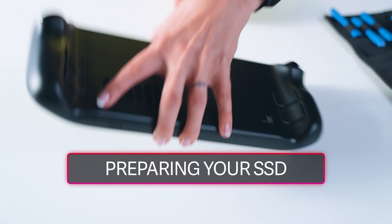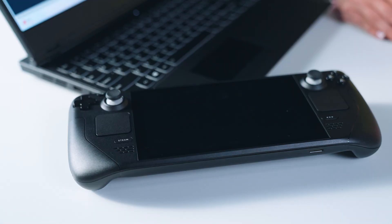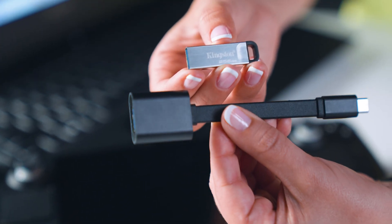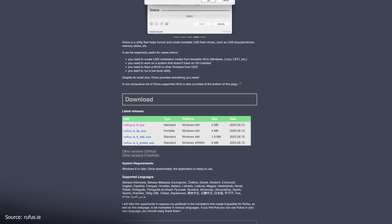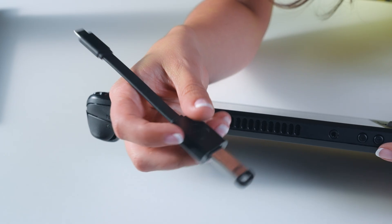The difficult part is done, and now you just need to install SteamOS on your replacement drive. You'll need another computer besides your Steam Deck, a flash drive with at least 8GB capacity, and a USB-A to USB-C converter. On your computer, download the Steam Deck OS from Valve's official website. Next, download a bootable USB writing tool such as Rufus for Windows to create the bootable USB, then use the tool to write the OS image to your USB flash drive.